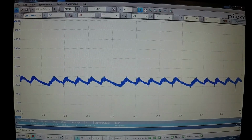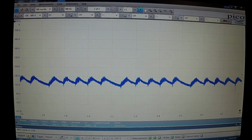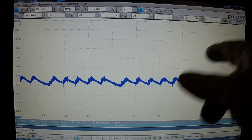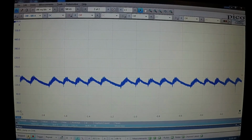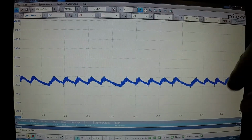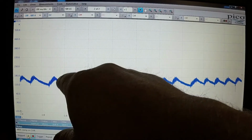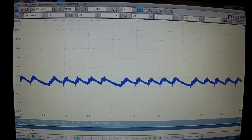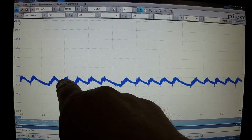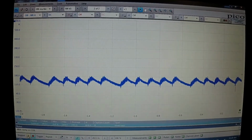You can do that by a whole bunch of different ways. If you have the adapter for the scope, you can hook it up and you can look at the secondary ignition and you can synchronize it with here. So you can plug the secondary ignition onto cylinder number 1, and that way you'll get a spark line every time cylinder number 1 fires. So say for instance, if this is cylinder number 1 and it fires here, then all you'd have to do is count the firing order. And on this engine here, I believe it's 1, 2, 3, 4, 5, 6. So if this is cylinder number 1, that would be cylinder number 2, 3, 4, and it'd be cylinder number 5 that would be missing, 6, and so forth.